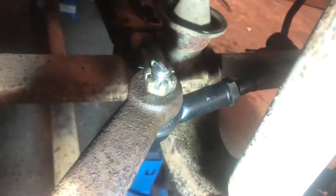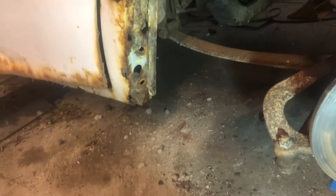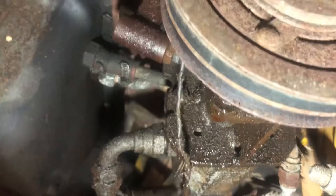Same on the other side, all back together. I did have to change one of the inner tie rods, which is really hard to find — it's a left-hand thread on that — but luckily I managed to come across an original Ford Motorcraft one, so that's a bit of a bonus. Now the next job is I've got to weld this arch up, get the tires on it. It's got power steering with a hydraulic pump, so I'll take the old hydraulic pump off and reroute the power steering belt. Hopefully that's just a straightforward job.